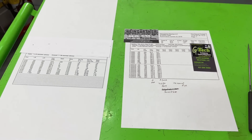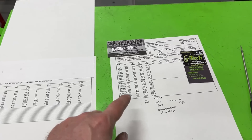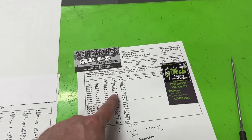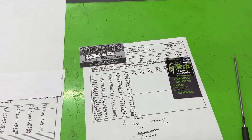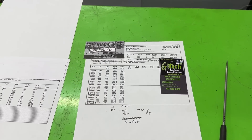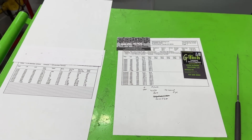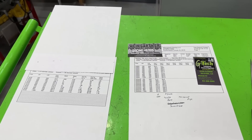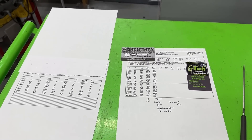So for you Ford guys, you've got a little bit of information. This head really should run better. It might not look like it gained that much, but 40 CFM at 700 lift is pretty good. The way it carries power, and even the exhaust flow - this thing is going to run much better and be faster. Now you've got some Ford information. Remember, I'm the Superman, which means I'm not perfect and I make plenty of mistakes. You guys take care, and I'll see you next time.